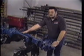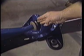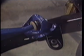In order to do that, we had to lengthen the radius arm approximately 15 inches. What we have done by doing that is eliminated stress here, eliminated some stress here, which will give us more wheel travel, better on and off-road performance.